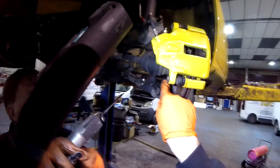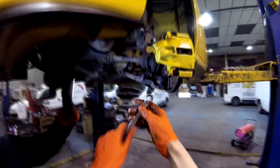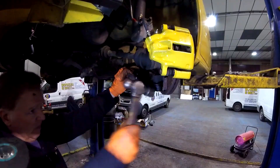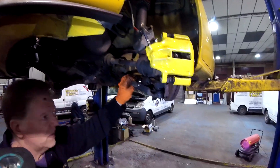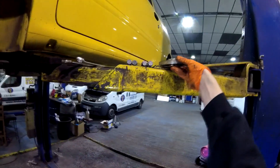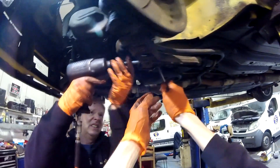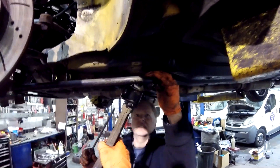Then it's just a matter of taking out some anger to get the ball joint out. Hammers solve most things — that thing at least. Now bored of manual tools, we use the air gun to help remove the various bolts and brackets holding the wishbone in place, before threading it out over the anti-roll bar and consigning it, and its standard rubber bushes, to the bin.